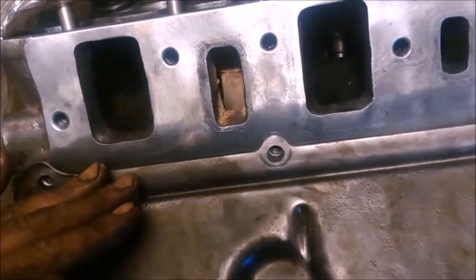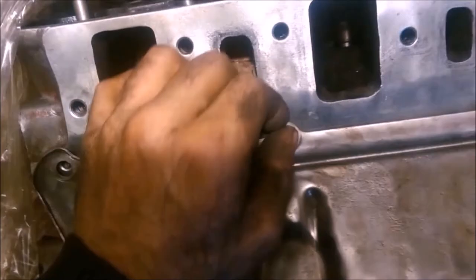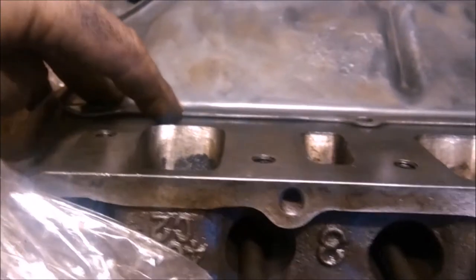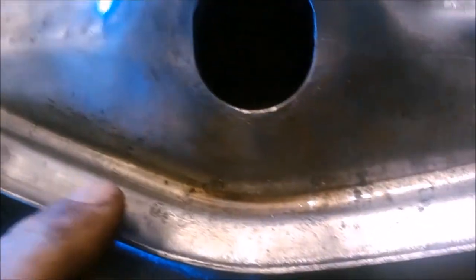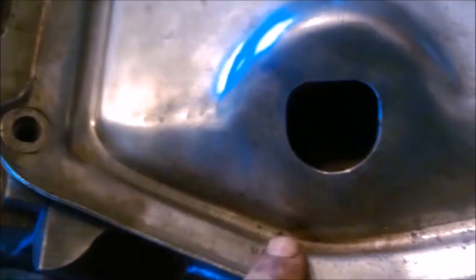It's on an angle. The same thing happens if you deck the block — you've moved this down, you've changed it. You now have to resurface this on a different angle so the new manifold fits. You could get crazy but once you start getting crazy you better have deep pockets. We'll dolly that up a little. You can see it was leaking before and someone tried to over-tighten it because it needed a gasket. You can see the hammer marks where someone put a screwdriver and hammered on it.